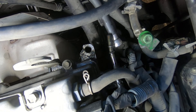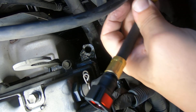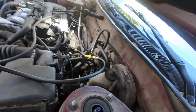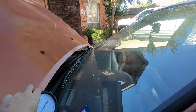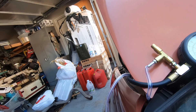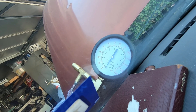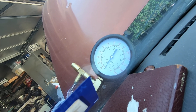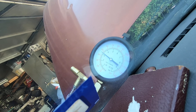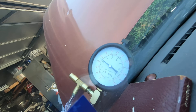I don't know why that ridge is in there. Now that the fuel pressure gauge is hooked up, I want to check the fuel pressure. I'll turn the key on — and with the key on we are not getting any rise in fuel pressure. So I'm going to try to start it; with cranking, the fuel pump activates and pressure builds as the engine starts.